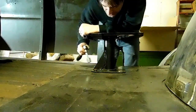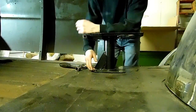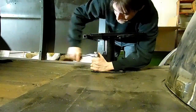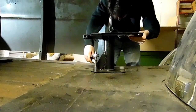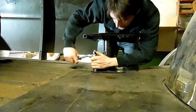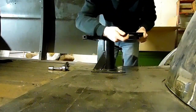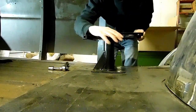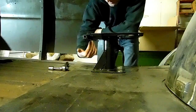This is how I tested these — I took one of the bolts, lined it in the various holes I was testing, and figured that this centered it up with the steering wheel the best. I would tighten it down as best I could, make sure it's centered while doing it — not too far to one side. With this tight and this tight it allows us to move this properly without it shaking. It latches when it's in the front position, and this one also has a latch on every quarter turn.